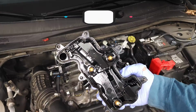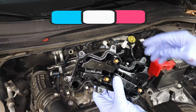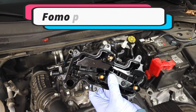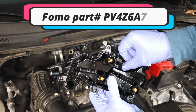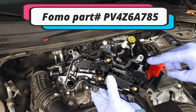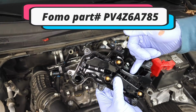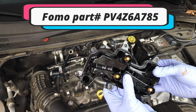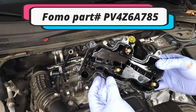And I want to say that what you should be looking for is, when this comes off, say if it's throwing a check engine light, you want to look at this gasket right here all the way around, okay? And if it's not properly seated, or you could see that there's noticeable dirt coming in an area, that tells you that the gasket is not working, wasn't seated properly. Okay, so that can be an issue with this.